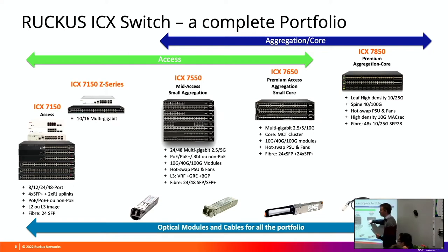Those 1gb ports - you can put a copper module in there and have 24 copper ports on that switch for things like connecting 1gb servers. With the 7550 you could put copper modules as well - they all do. There is a limitation though with our 10gb copper module: I think it's 30 metres is the limitation, because there's a limited power output with those modules.